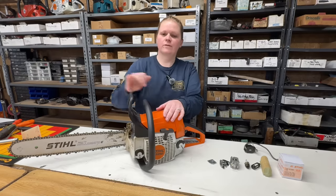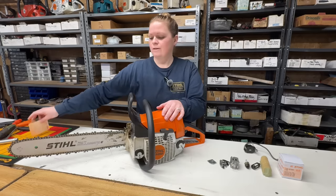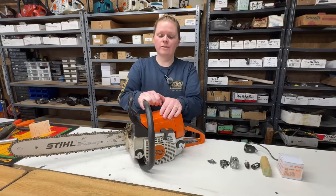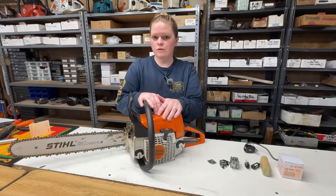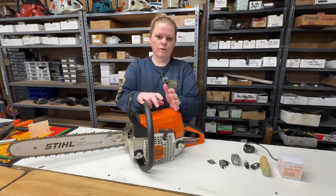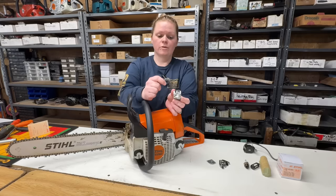I've pretty much been through this whole saw except for one thing: the carburetor. When this saw was dropped off, nothing the customer said signaled me to look at the carburetor — he said hard to start and it kicks back. I hear this often with MS 250s because they are a high compression saw and they are hard to pull over. When I first became a Stihl dealer, one of the first things I was warned was to be careful who I sell MS 250s to, because once they break in they can be hard to start. So all that's left is the carburetor. The first thing I notice is the limiter caps are both missing, and both jets are three turns out, which is not correct.